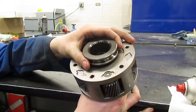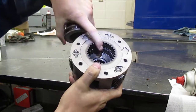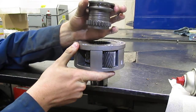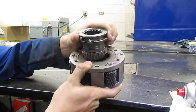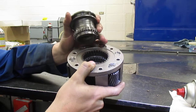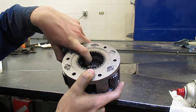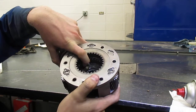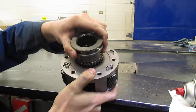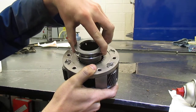As you can see, this is a planetary gear set, and this is from the same vehicle. There's a whole bunch of different teeth in here. This is the same shaft which is connected to the range selector fork. As it moves down or higher it selects different ranges. Down at the bottom is direct drive — a one-to-one ratio for all high: two-high and four-high when it is engaged. In between them is neutral — when it's in between them it can spin freely without anything else moving inside.